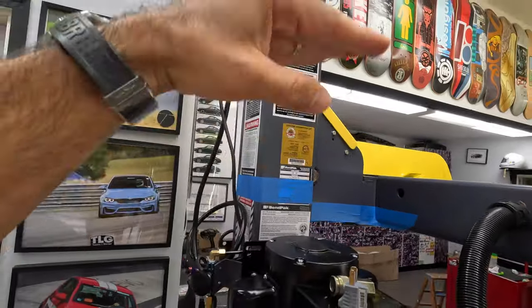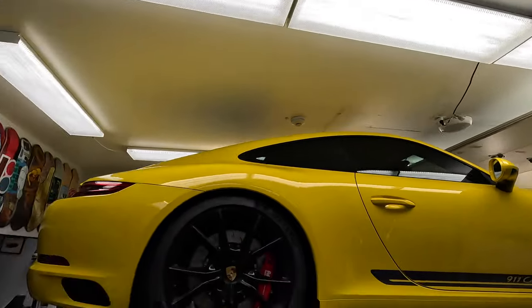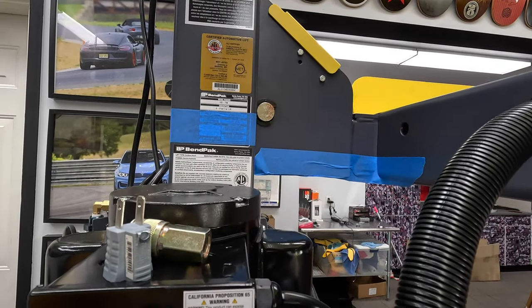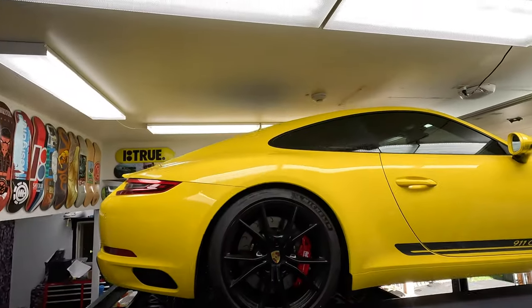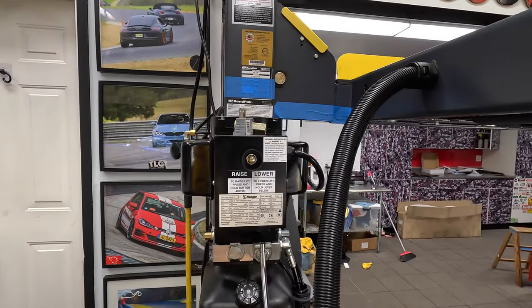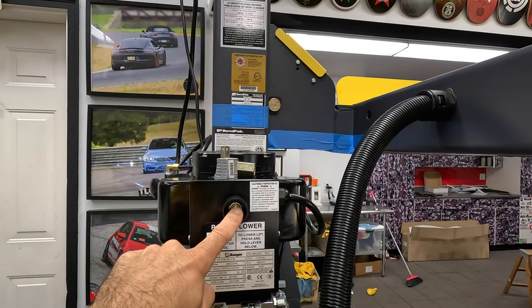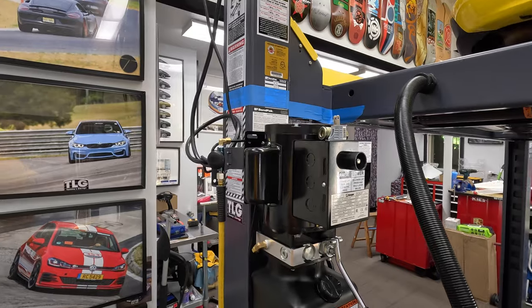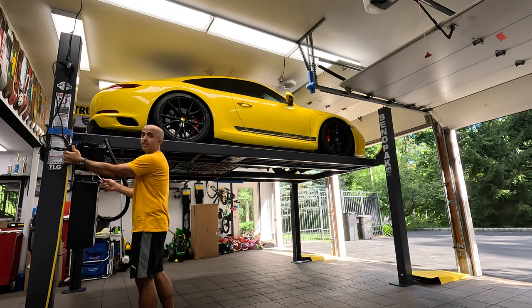One final thing to note: there's no limit on how high you can bring the car, so you have to set your own limit — if you raise it too high you might end up crushing your roof. In my case, at the highest safe setting I installed this tape as a marker. When I lift it up and reach that tape, I know that's the highest I should go before engaging the brakes. You simply lower the brakes and it rests on them. To lower the vehicle, you raise it up again slightly to loosen the brakes, then press the button and lower the lever — and it will lower the lift. Make sure all towers disengage and drop it slowly.